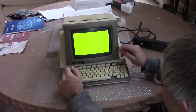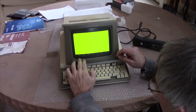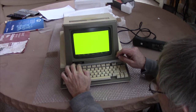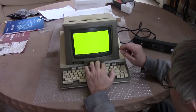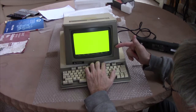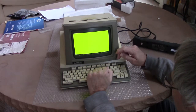This gets you into setup — communications, modem, baud. Can that go to 19.2? I don't believe that. I'll set it to 1200. I don't know what P is — space parity — 8 bits. Mode: half duplex. That's why it's echoing. I'm going to put it in full duplex mode. This would be flow control — hardware flow control. I like that.